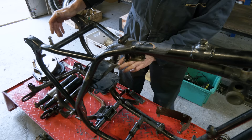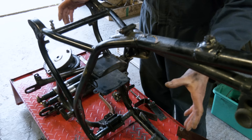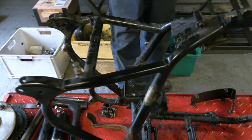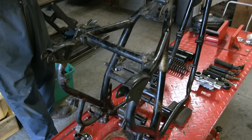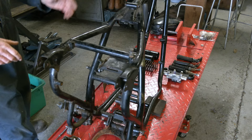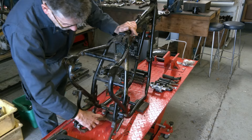It's on the front. Also, quite interesting, we've got the battery tray here, but below we have a platform, and this is for competition use. You would take the battery off, you wouldn't have a dynamo, you would have a central mounted oil tank — and that's what that's for. So in '59 that was fitted to the standard. So this is going to be a nice bike. We stripped it down because I want to make sure everything was genuine.